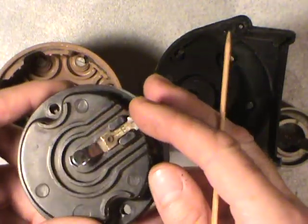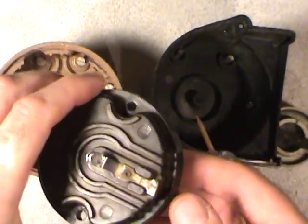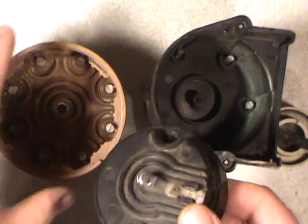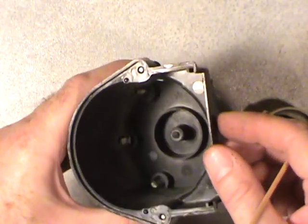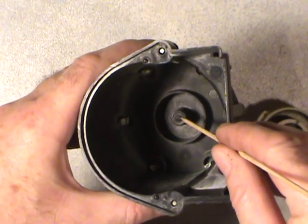Erosion would usually take place at the tip of the rotor as it circled around inside the contacts in the distributor cap. So this was the industrial-strength model, if you will — that's the word I'd use for it. I don't know if the aftermarket folks come up with something heavier duty, but that little carbon button in there is going to be your number one problem maker once it wears down.